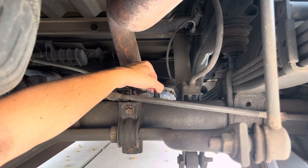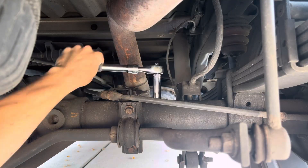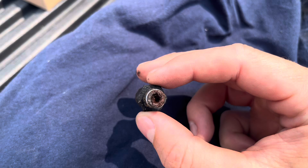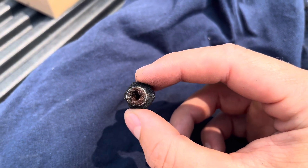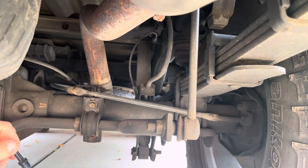To get started, I'm going to pull my truck up on these ramps for more clearance. This right here is the vent we're going to be removing. I just popped this OEM vent and — take a look at that — my truck only has about 20,000 miles on it and there is already a ton of rust, corrosion, and dirt in there. This thing was probably almost clogged. I'm going to go ahead and get this new nipple installed.